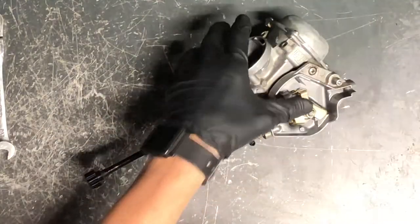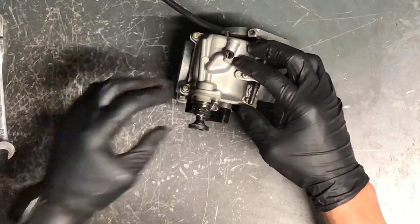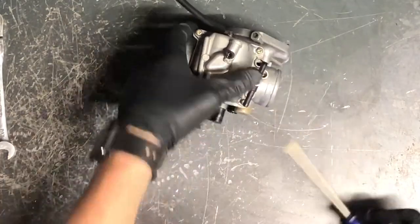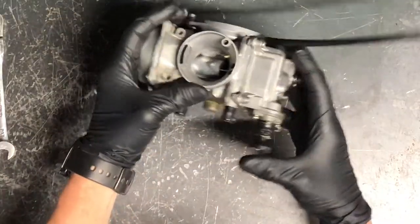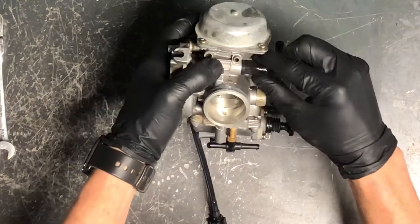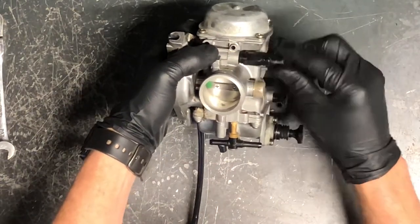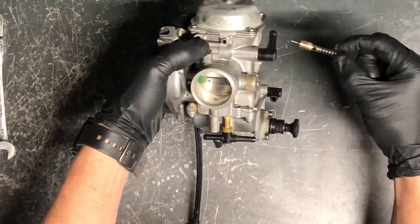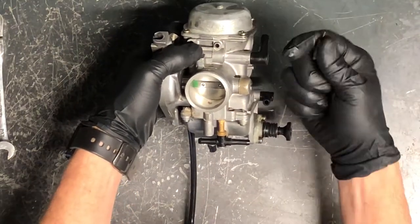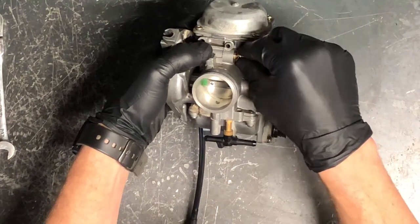With the cover pulled off, we've got your bowl here held on by four screws. We've got a plunger here — excuse me, a primer here — and the choke here with a 12-millimeter plastic cap. There's a cable that runs through here, spring-loaded, with a plunger on the end. This is a common problem area — these get stuck.